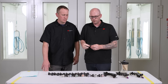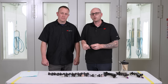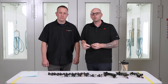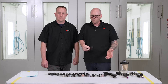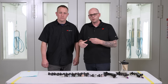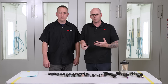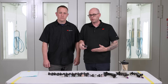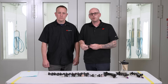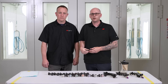One thing to keep in mind: our nozzles are reusable. If you clean them properly, you can get well over 100 refinish hours out of every individual nozzle. It's easy to know when it's time to change — either you left a 2K coating in it and it's now catalyzed inside making it very hard to clean, or your pattern starts to degrade from heavy use. If either of those things happen, put on a new nozzle and you'll have like-new spray gun performance.